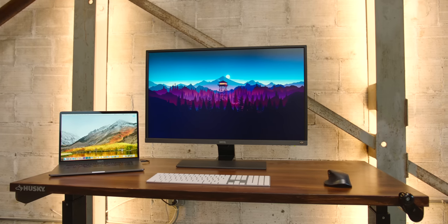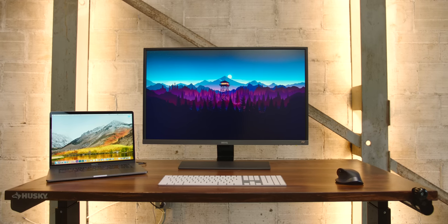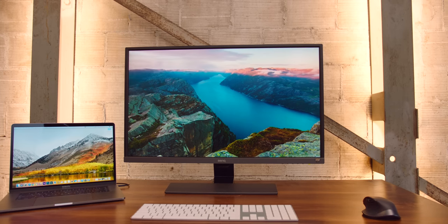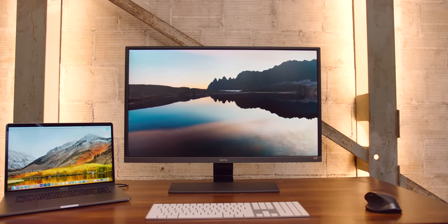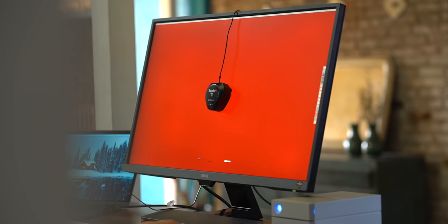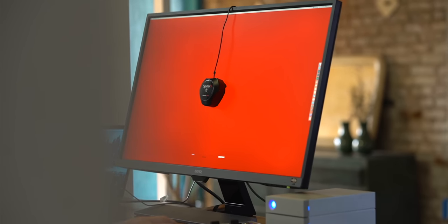As far as the monitor goes, we didn't want to go crazy expensive, so we met in the middle on size and performance. This is a 32-inch 4K 10-bit HDR monitor from BenQ, and it connects via USB-C. It has P3 color space as well as 4K, so it looked pretty great — but out of the box, color accuracy wasn't quite perfect. So we used a Spyder 5 Express to calibrate it so it could match the MacBook Pro monitor, a printer, or any other digital devices. Even with a high-precision monitor, it's good to calibrate your colors about once a month since they gradually drift.